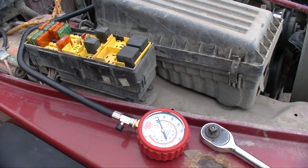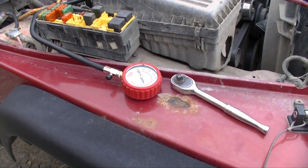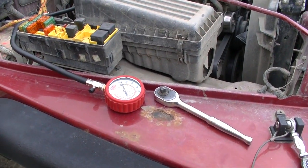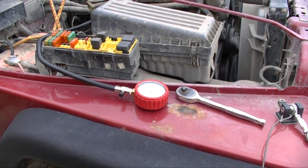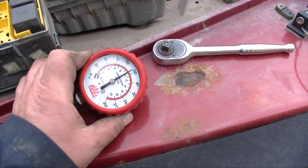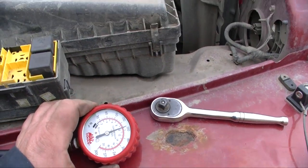We found one cylinder that's a little on the rough side. We're just gonna do a compression test on this one hole to see what the compression is — fuel pump relay's pulled out. It might sputter for a second. That hole is good — your compression is way harder than my engine, almost hitting like 150.